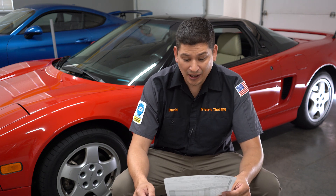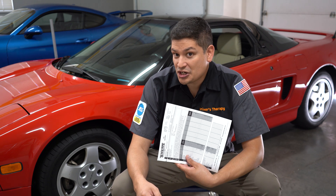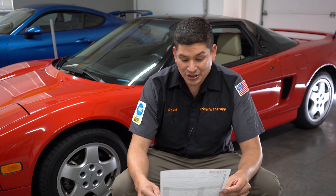Really, if you think about it, a lot of people don't drive that much — so that's a different story. But I ended up changing the fluid, and if I knew this information, I probably wouldn't have. So all you Genesis guys out there, if you haven't changed out your differential fluid and you're not even close to 150 or even 200,000 miles, I think you're good. I personally would change it around 250 to 300,000. But if you think about how much mileage that is, there is some truth in the fact that lifetime fluid is real.